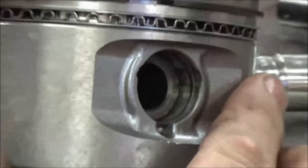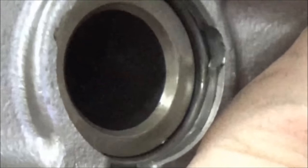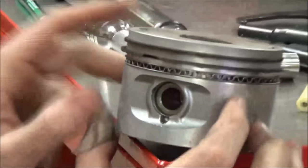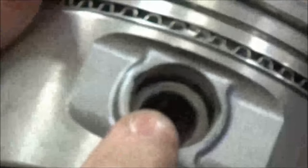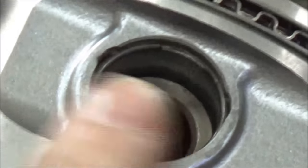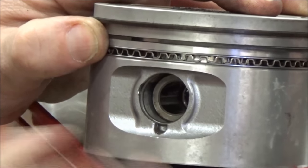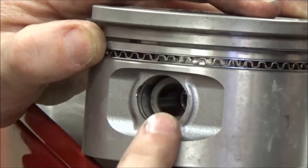Let's back it up and get the other side. Zoom in there. You can see that when the piston pin is in there, you can see how good that is. A couple of last notes here. You've got the open end of the clip — you can see ours is at the top here. See the open end there. What we don't want is the open end by this relief right here. I know we're doing a Harley video here, but this can be used on a lot of other things, and where you place that is important.